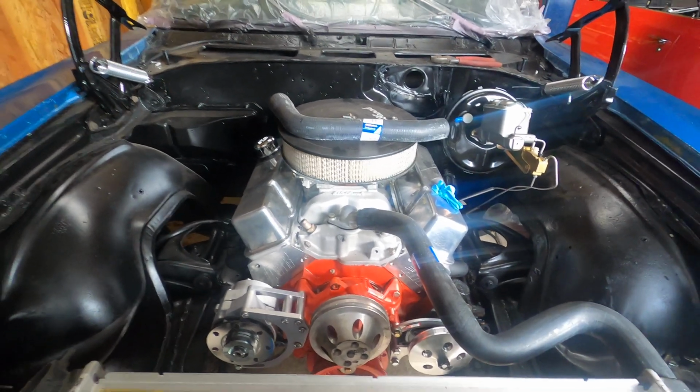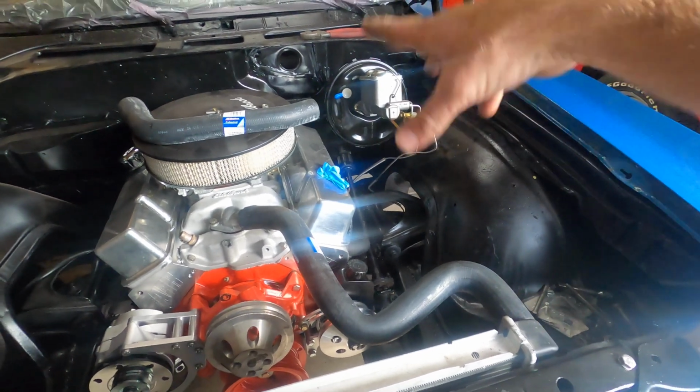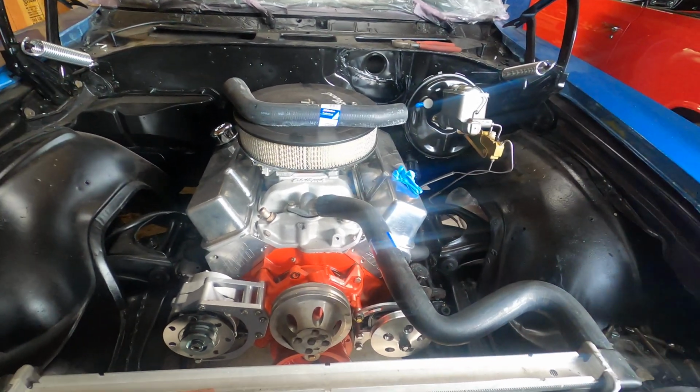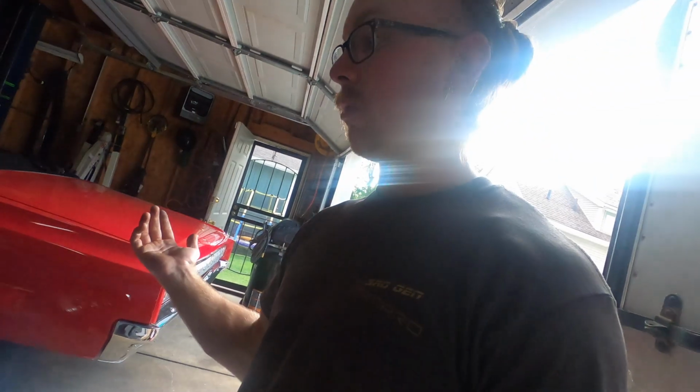So yeah, get some oil in this girl. We got to get our valve cover gaskets on, but I want to pour oil in this thing over the rockers and stuff like that before we start it. So we'll pull the valve covers off, pour the oil in, and put the valve cover gaskets on. And then hopefully in a few days or something, we can maybe bark this thing to life. We'll see what happens. We need a starter. That's what we need, is a starter. We have the old one that we could just bolt on for now, but I'll get some stuff coming. I'll see you guys soon.